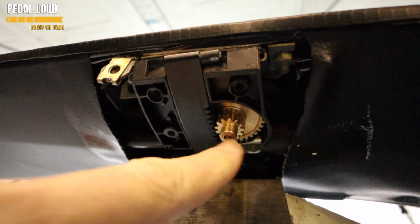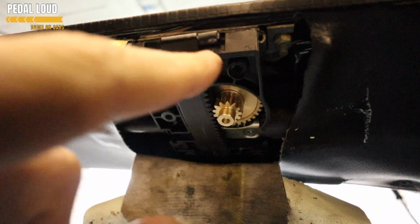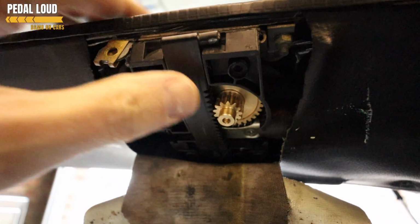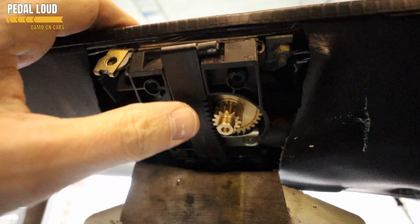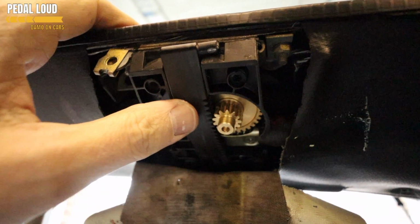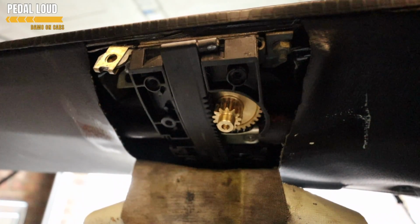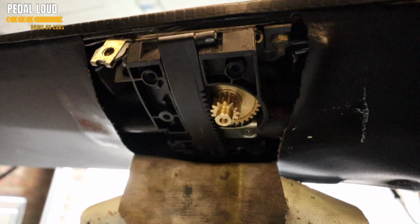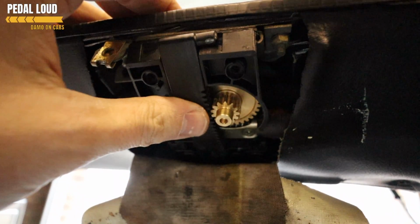Okay, so we've got a new brass sunroof arm cog, and the sunroof is in the lowest position. So this is in the removal position. Normally the sunroof, you have to assume, is in this position when you want to take the whole thing out. So what you've got to assume has happened here is the ignition has gone to accessory. That's the first turn. No lights on the dashboard. Accessory, 1 turn. You are able to press, this is what should happen, the up arrow on the sunroof button on the center console, and it will retract the arms into this position.